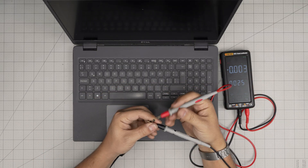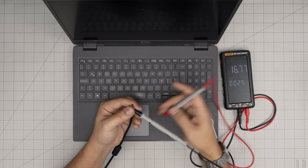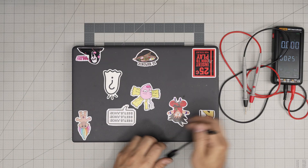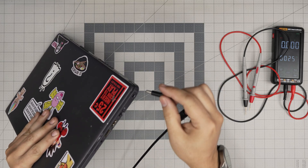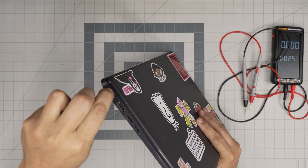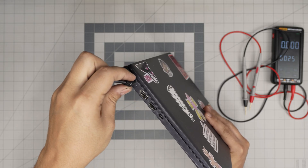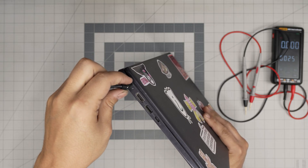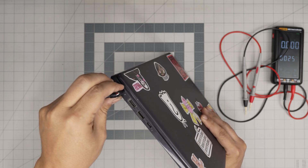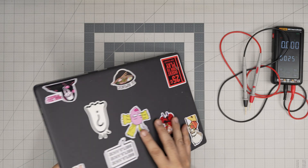We can see the negative is on the outside and the positive is inside, so we have 19.10 volts — which is fine, no issue on the tip of the charger. When we plug in the charger we don't see any light indicator on the side of the jack; we should see a blinking or white light. The client had to move it really hard left and right before it started showing, so we're just going to replace it — that jack is really taking a beating.